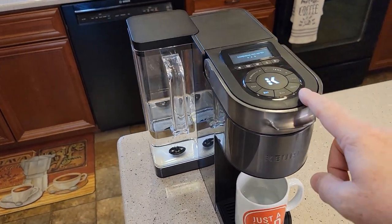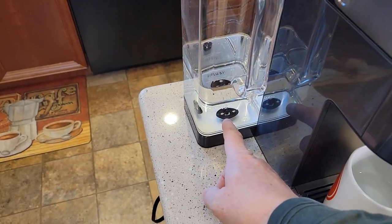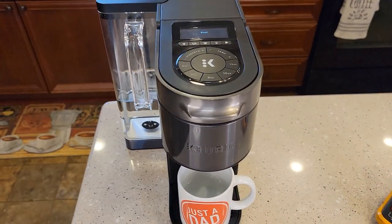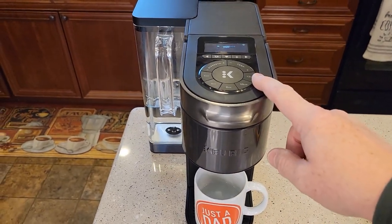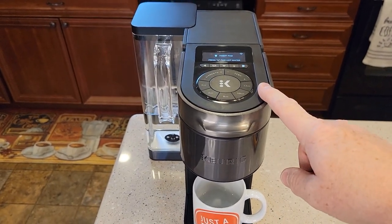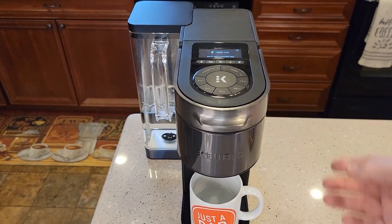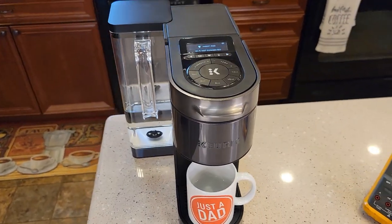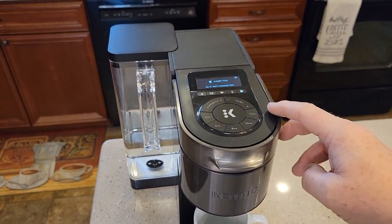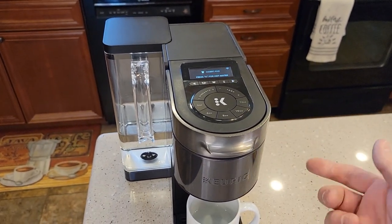The two reasons I think that thermostat overheats: if you brew a cup and the low water light doesn't come on, or if you remove the reservoir accidentally and it runs dry — I think that pops it. During a descale, you're running so much water through it that it overheats a little bit. There's a suggestion to let it cool down after you run the vinegar through and before you start the fresh water rinses — let it cool for 30 minutes, but the machine has to stay in descale mode for that 30 minutes, then do the fresh water rinses.